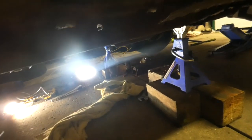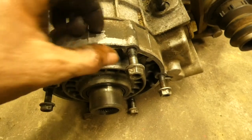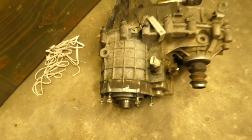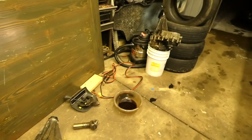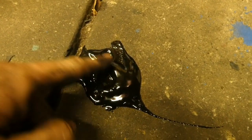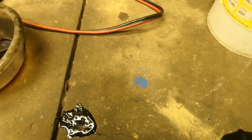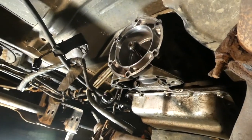I've got the jack underneath. Make that level for now until I scrape my gaskets and prepare the surface. I've also got to prepare this surface - get it nice and clean so that gasket will sit on there pretty. We'll put some Yamabond or some gasket seal, whatever I got laying around. Get that bad boy back in. That's where I wanted to get tonight. Tomorrow morning we'll start prepping, getting things ready. What in the hell is that? Is that out of the freaking transfer case? No way. It's like goop. That might be chain shards. I want to open this up and let it drain because I want to see what comes out of here. We're going to do that tomorrow too. Got it propped up, it's going to sit there like that for the night.